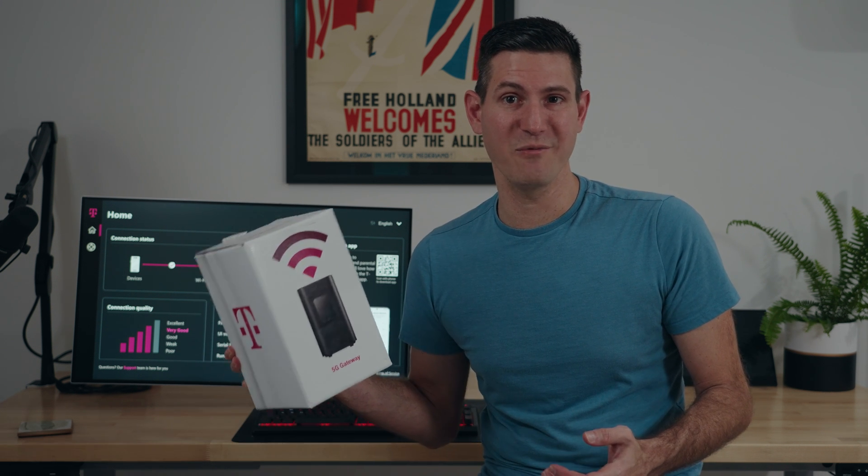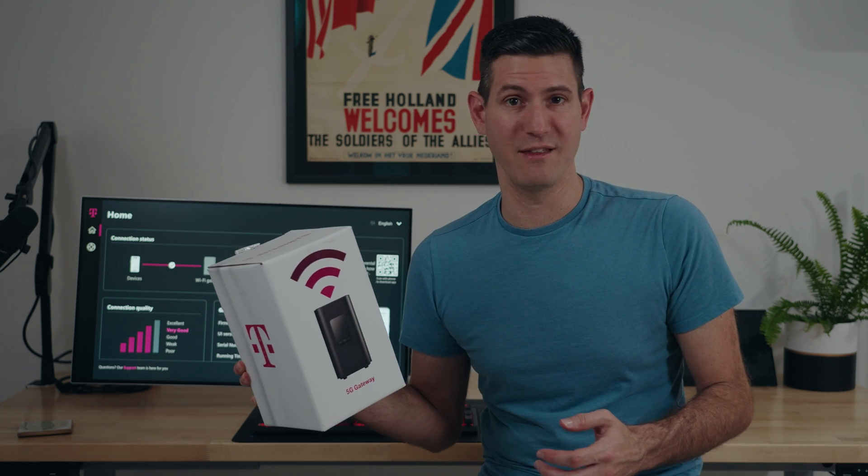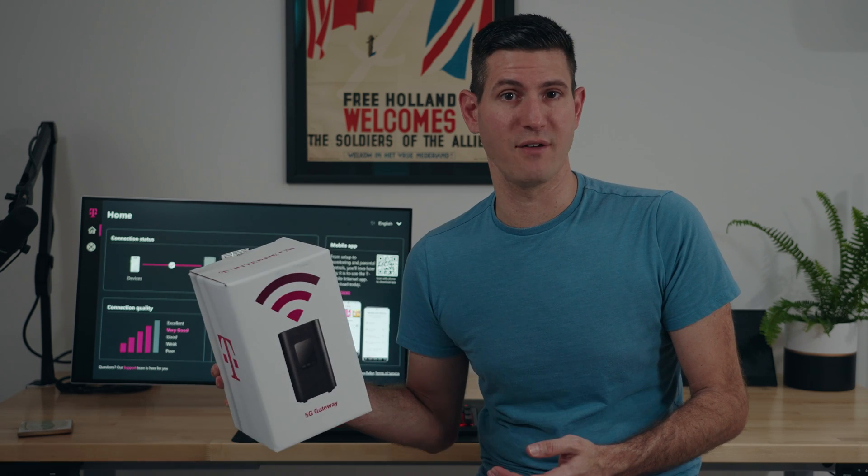To turn off the Wi-Fi completely we have to leverage the web-based API and query it either with community-made scripts or, in my case, using a PowerShell script or Postman to send API requests to the modem. Basically, we use the username and password set on the modem to create a bearer token, which then allows us to make API calls to the modem.